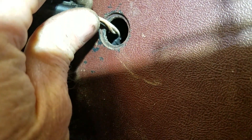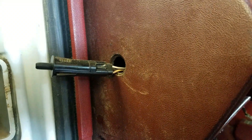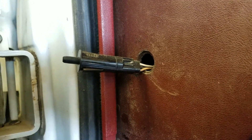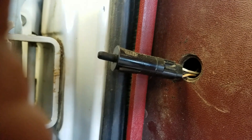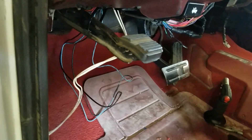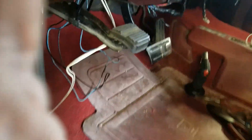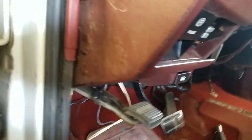In here you can see where they connected the electrical wire — there's a lot of electrical tape in there. These two white wires don't have any juice going to them at all — they're negative. So if they touch something metal they're not going to short out anything, but they could turn on the dome light. I'm going to continue working on this and try to figure it out. I don't know how I'm going to reach those without going all the way up to the dash, which I might have to do.